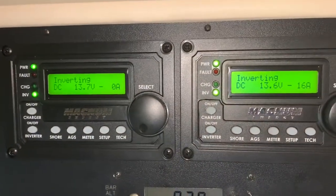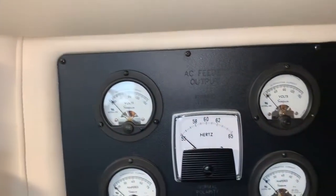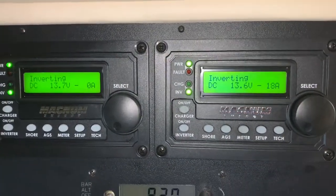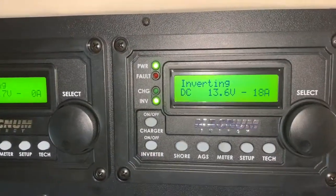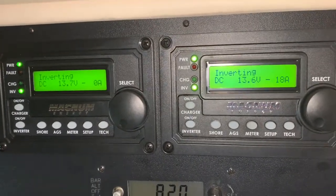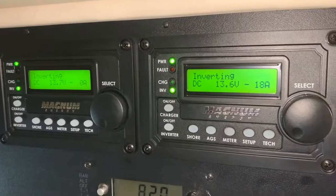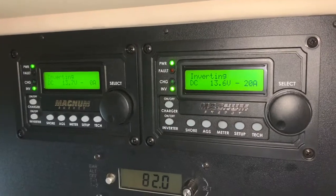Okay, I have the engine running. Shore power is disconnected. As you can see, we are disconnected from shore power. I turned on the refrigerator just to make sure that the voltage would stay good, and it's 13.7, 13.6. We're drawing a little bit of current. So the house batteries are charging off the engine, and it seems to carry a load just fine. So I'm pretty excited. We got the first problem solved, and now we'll move on to the mirrors, and I'll make a separate video on the mirrors. Thanks for watching and have a great day.